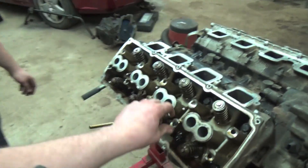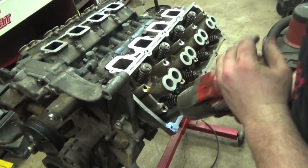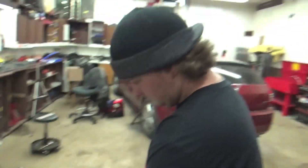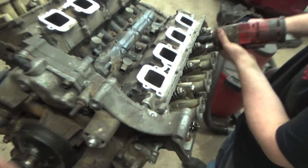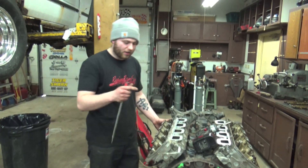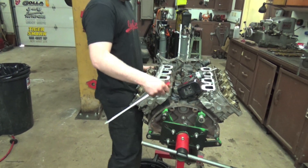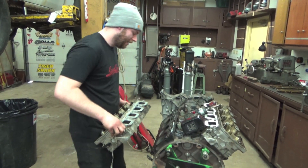The same thing on this side, guys — keeping the order of the old push rods. Now we're breaking some head bolts loose. I always do this in a reverse spiral going inwards so you don't warp the head, because it's an aluminum head and you don't want to warp it. You also can get the heads off without taking the intake or timing cover off — there's a sneaky bolt right there and a little bracket that goes across. Now that we got all the head bolts loose, we're going to use a little screwdriver to pop her up and not drop the head.